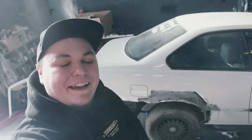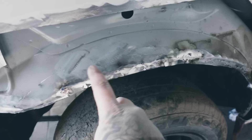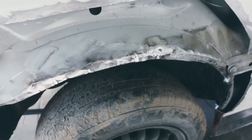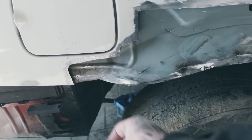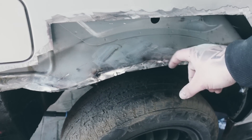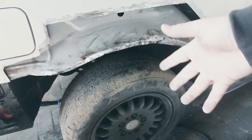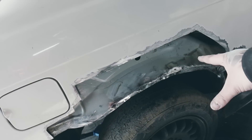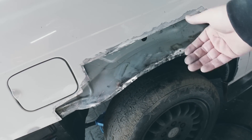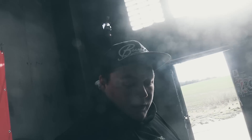That went pretty quickly and easily, I must say. The inner wheel arch has been reconstructed. We've inserted one panel here, one here, and one here. And we also had a cut in here that we had to weld shut too. You can hardly see anything — well, of course you can see it — but the important thing is, when you weld something like this, don't leave any holes. Everything must be fully welded shut, because wherever a small hole remains, water will get in and everything will start to rust again. I've welded twice — welded, ground, welded, ground — and now everything is flush.